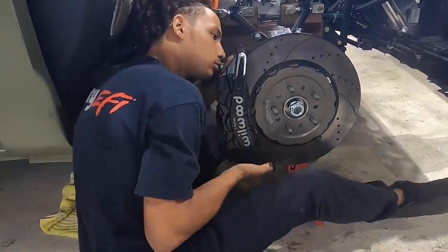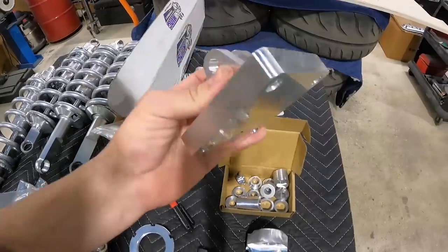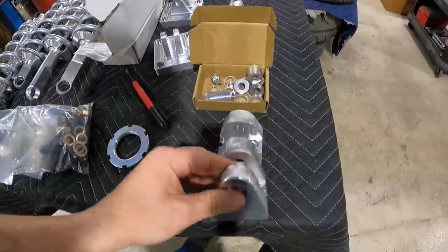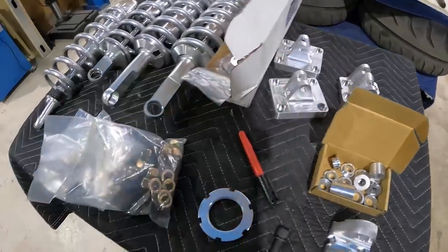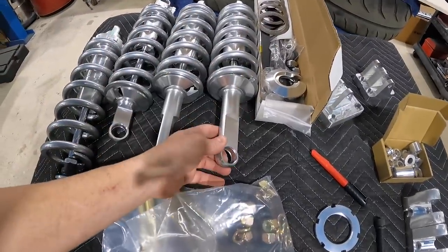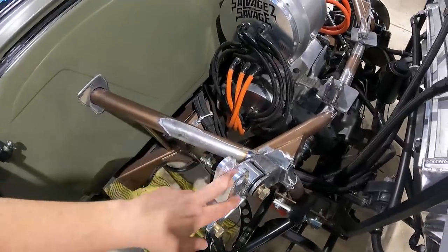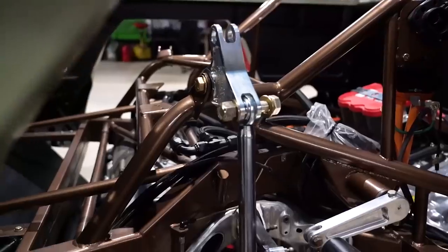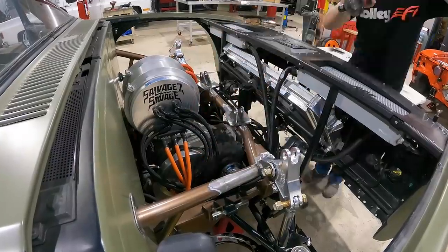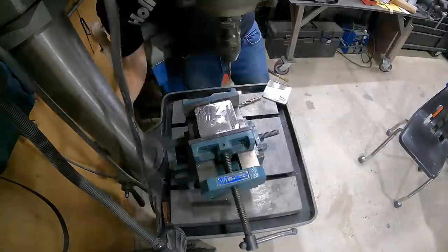The time has finally come to do the final mock-up on our push rod suspension for the EV truck. Mikey went over to JC's and made some really cool washers. We also got new brackets — these are our base plates. The older ones were a little off on dimensions, so JC made new base plates for the front and rear of the truck. We got our coilovers all situated. We're going to go ahead and put our bearings into the end links and start putting the front end together. The front was tacked on with a metal base plate since the machined parts weren't in yet, so we'll cut that out, finalize our ride height, put the coilover in, and see where our new base lands on the new plate. The back end is looking nice — all our push rod modifications are done.